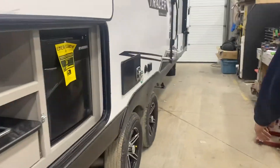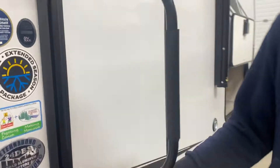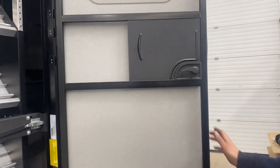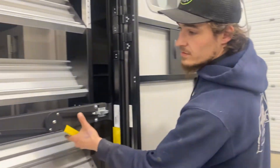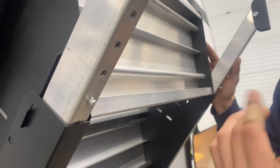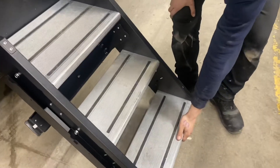We'll just make our way inside. Here's this handle here — just up 90 degrees, falls into place, then we can open up our door. The door is just on a friction hinge, so it just sits wherever you leave it. The yellow handle either way will undo the latches, and then the stairs will fall out. You have two little quick pins on either side, so you can pull those out and extend or retract your legs as needed to make sure they're level in your campground.